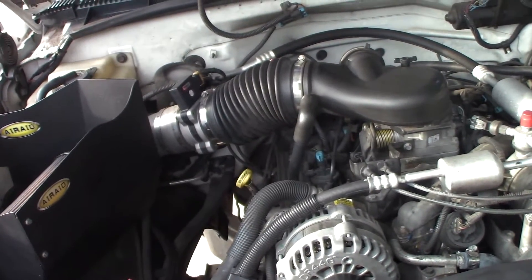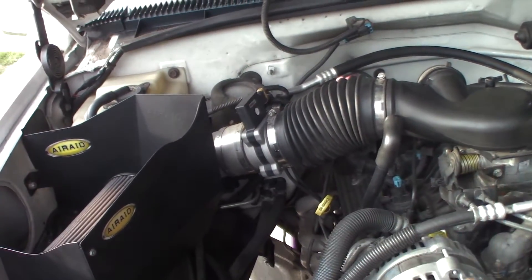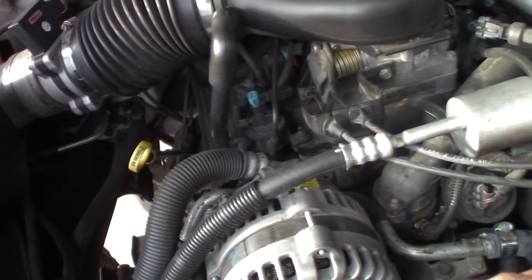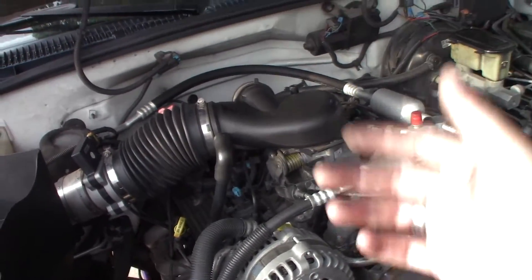I guess we'll see within the next few days — I'll try to drive it and see if it starts any better. It was a cheap fix and that sensor probably really needed replacing anyway since it was still factory. So we've got the new MAF sensor, the throttle position sensor is brand new, the PCV valve is brand new, and the IAC sensor I changed a little while ago — still not really any change. It's probably unfortunately going to be the injectors. I prefer to try the less expensive options first. You never want to jump to the most expensive and hardest thing first — get the little things out of the way and see if they touch or cure the problem.